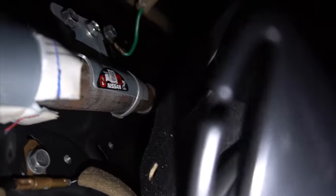On the passenger side there's a 10mm bolt you need to loosen — it's probably for the airbag connector. You can see where the brown wire is — that's the 10mm. On the other side there are no wires, everything's already disconnected. Once you handle those quarter panels, it's mainly just clips and the headliner drops down. You're going to want to pull it out from the back. I'm going to loosen that 10mm and start actually dropping the headliner.